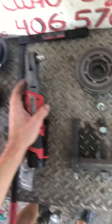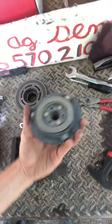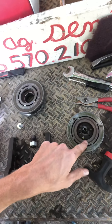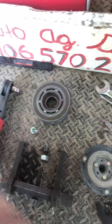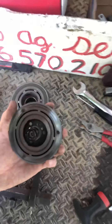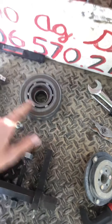So let me show you what I did. First step, I just used this bad boy right here — just buzzed off the nut that holds down the hub plate. This actually turns the compressor itself. So once it's energized, this plate is sucked to the face of this pulley and it causes it to turn. Buzz that right off. Don't forget there's shims inside of here that set the gap between these two faces.